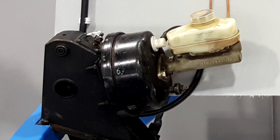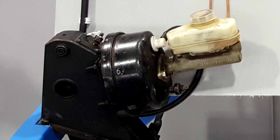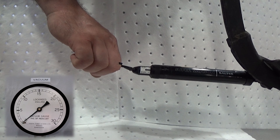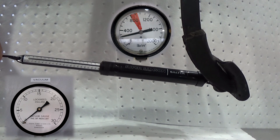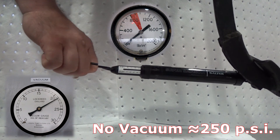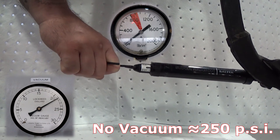So this leads us on to the second question: how much are the brakes boosted by? This can vary between manufacturers, but what we have here on our training rig is the master cylinder and servo unit from a Land Rover. We're going to do a couple of tests and look at the brake pressures while operating the pedal at a constant force. The first test is with the engine switched off, so no vacuum for assistance. With 20lbs pull on the brake pedal, we get about 250 psi brake pressure. Now let's start the engine and get some vacuum. With the same 20lbs on the pedal, we now have almost 500 psi brake pressure.